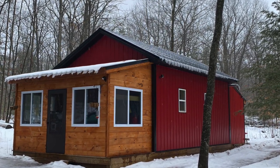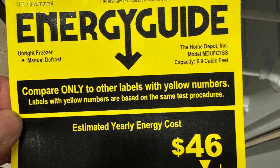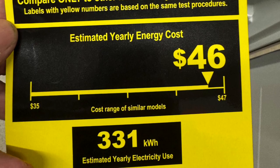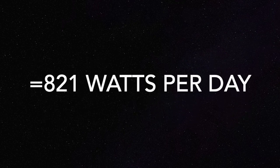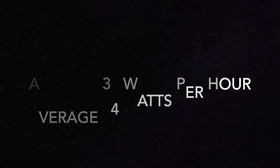As a comparison on appliances, I looked up a typical AC fridge of the same size — 10-cubic-foot — and checked the Energy Guide rating. For round numbers, it's about 300 kilowatt-hours of power per year, or 300,000 watts per year. Divide by 365 days and that's 821 watts per day, giving an average of 34 watts of usage per hour — and that's the refrigerator only.